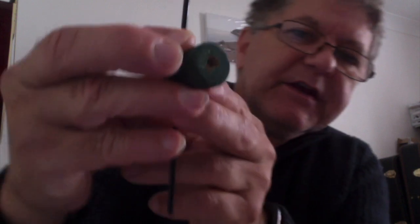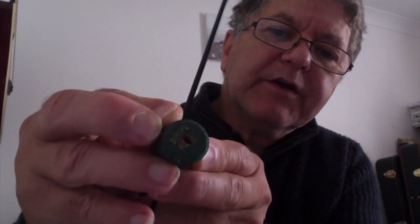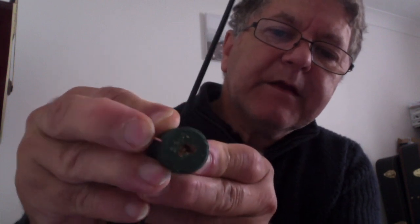You don't need a pair of pliers to do this at first because the pin is already located. If I push the pin down towards the top of the float you can actually see the top of the pin. So if the pin is already in and you need to remove it, you can either use a pair of pliers to get the pin out or push the pin from the other side. You can get a pair of pliers at an angle and push the pin out so it protrudes.